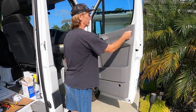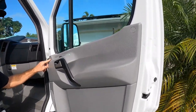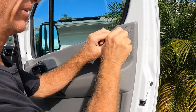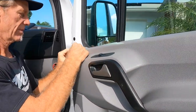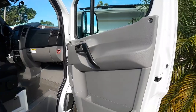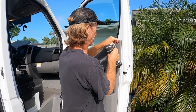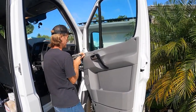To pull the door panel off, there's a cover here that hides the screw, and there's one over here as well. You have to pop these little pieces off — they're kind of a pain. You can see it looks like somebody's tried to do it before and made little scratches. So that's the first thing we're going to do — pull these off. Same thing over here on this side. It shows a Torx bit behind it; it's a T20 Torx bit. You need to pull that out, making sure to place it somewhere you don't lose it. You will need this upon reassembly.